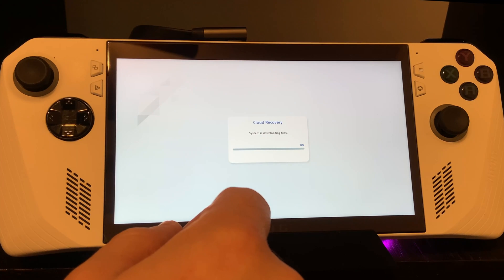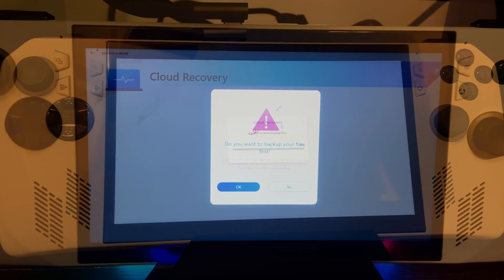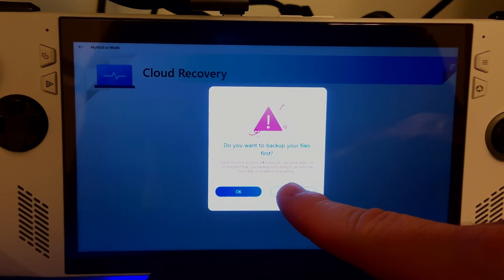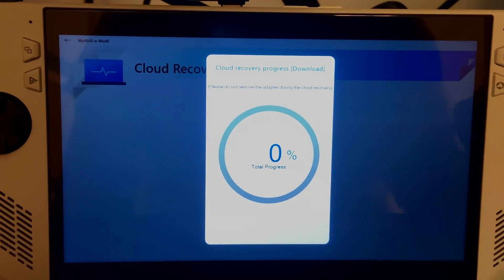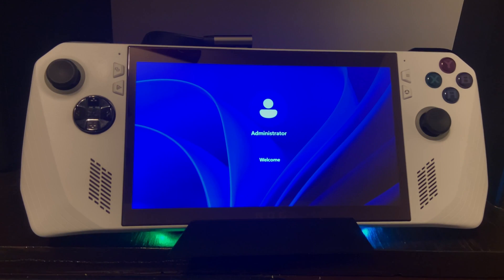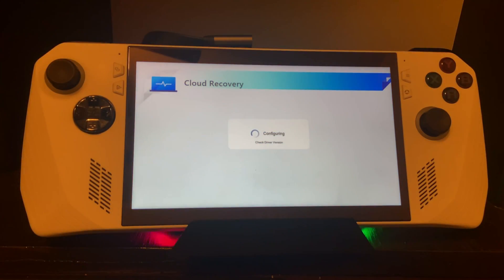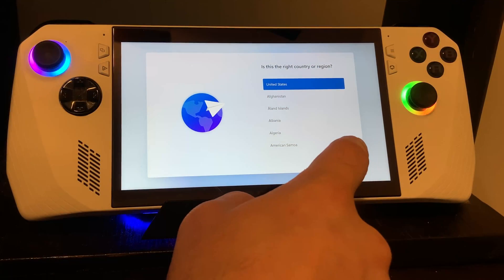Make sure you're plugged in through the whole process and do not interrupt it. Eventually you'll get to a screen that asks if you want to backup first — choose No. The next prompt asks if you want to begin — choose Yes. About midway through the install, you'll see it sign into Windows a few times as administrator. This is the image copying all of the ASUS programs and drivers. Eventually it's going to boot into the normal Windows 11 out-of-box experience. At this point, we do not want to set up the device — we just want to shut it down.